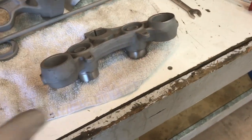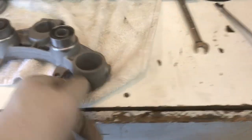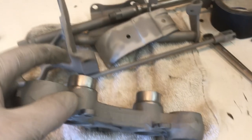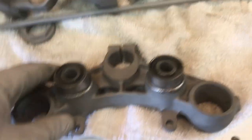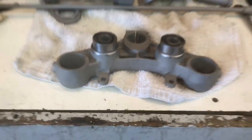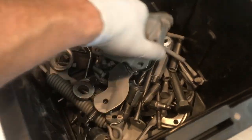This top triple tree doesn't get parkerized — I just pulled it out of the sandblaster. When you go to restore or repaint this, make sure you take the rubber dampeners, hit them with the wire wheel, and then tape them off, because these are not supposed to be painted during restoration. So we're working forward and all these items go black.